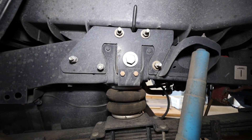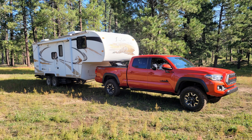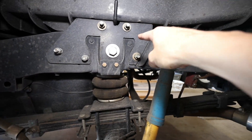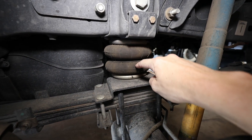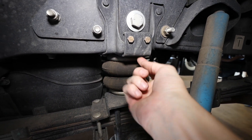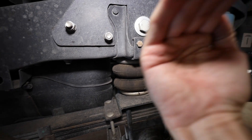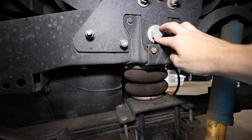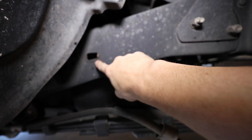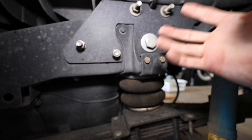This is the left rear. If you're wondering what this is, this is for my gooseneck hitch — I tow a gooseneck trailer with my Tacoma. I just did a video about that hitch last week, so go check that out. This is the airbag that's installed. It has a bracket that goes up right here — part of it bolts on the outside of the frame, and the other piece has an arm that's curved and bolts right here with this huge bolt. The hole is already in the frame; it's like a square hole. This is the bracket for the gooseneck hitch, so it's all bolted together.